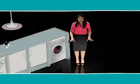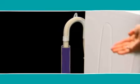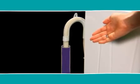And finally, if your floor's covered in water, double-check that the outlet hose hasn't got unhooked from the drainage pipe.